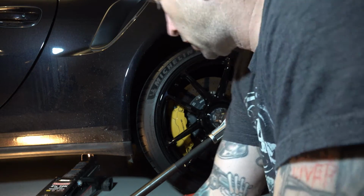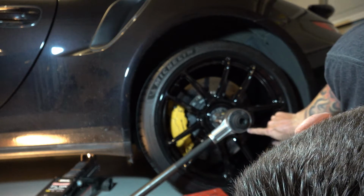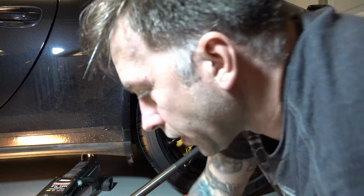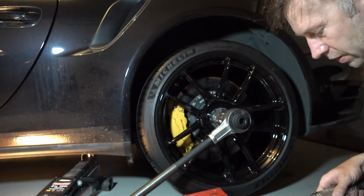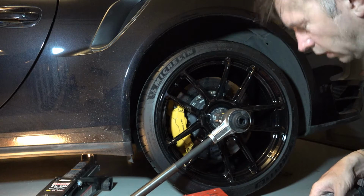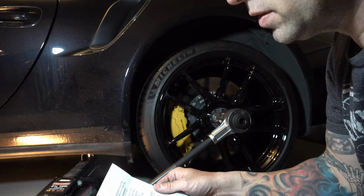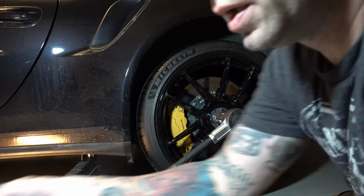I need that to be at 600 Newton meters. And I've got a 3-to-1 input to output, or vice versa. So that means I need to do 200 Newton meters on this thing. Okay. And then we've got a little bit of loss in it. So if I do, and this says you might have 10 to 20% torque loss, which is quite a bit.